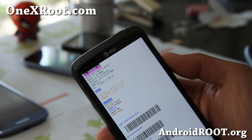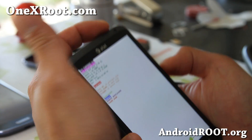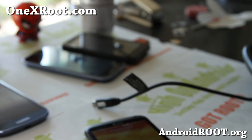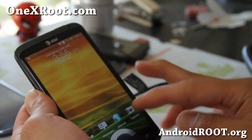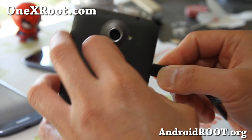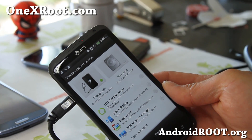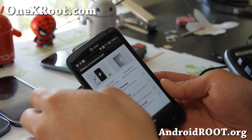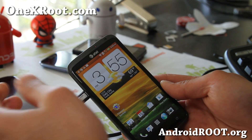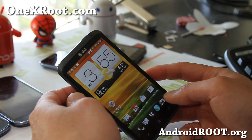I'm going to go ahead and reboot, choose fastboot there, and simply go to reboot. Once your phone has rebooted, simply plug it into your computer. You can also be on any kind of custom ROM — you don't have to be on a stock ROM. Because the RUU will probably erase everything, do make a backup of your internal storage. Use Titanium Backup to back up your apps, and then backup your whole internal storage. If you made a backup ROM, that will save everything also.